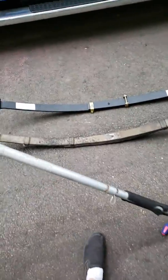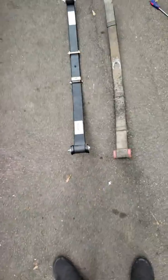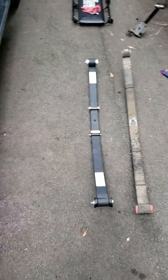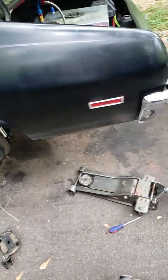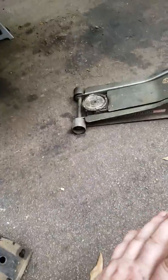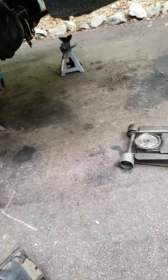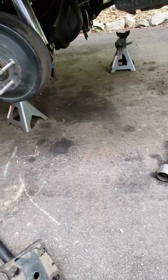And this split mono is going to lift my car 1 inch, so it says, which will help me fit a fatter slick under it, which is really what I need. I think on these 9s I can't take off as hard as I want to, and I think that with these split mono leaves and then putting my front end back down some, they're not as stiff as the multi-leaf, so the double adjustable shocks can actually do their job. These multi-leafs are so stiff that shocks can't do their job.